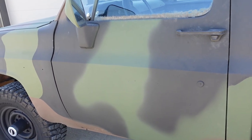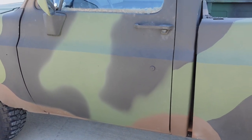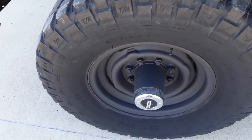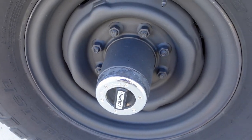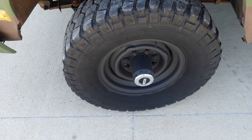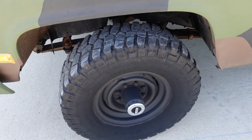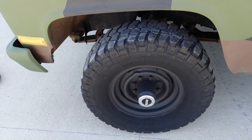We're only talking about $24 a gallon and you're probably not going to use a whole gallon to do a pickup like this. For the wheels, I used the HVLP gun and narrowed the pattern down to basically ballpoint-pen size to go around the rim, then fanned out the pattern for the middle. That turned out really well, but I will say the durability of latex on a wheel getting blasted by rocks is not very high. I would use Rust-Oleum flat black instead — it has more sheen, but it's way more durable and sticks a lot better.